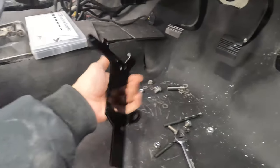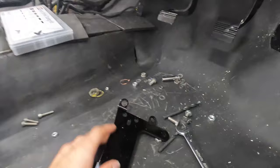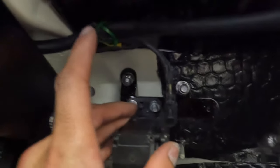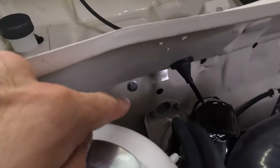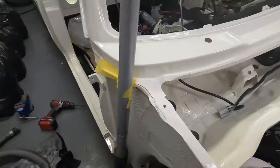I've given it a coat of paint, drilled the hole, and painted inside the hole so it doesn't rust. Now I'm going to bolt everything together — mount the pedal first, tighten it all down properly, then mount it to the car. The pedal is in now and bolted up at the top, plugged in, and zip tied to a tab. The pipe for the reservoir is also zip tied. The pedal presses down fine, doesn't shake or wobble — feels quite solid. In the engine bay there's one bolt here and one down there going to the two mounts with washers pulling it nicely.